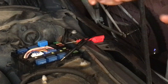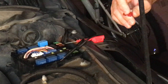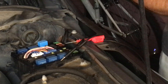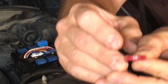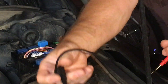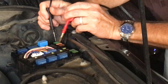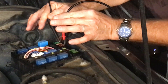I want you guys to appreciate where I am and what we're actually doing, because there might be viewers new to the concept of measuring voltage drop to correlate it with current draw. What I'm doing in the fuse box is going across the two contacts on the fuse. I've got my probe set up — no standard ground clip — because I'm looking for the voltage drop across the two test points on the fuse itself, simply going across the fuse inside the box.